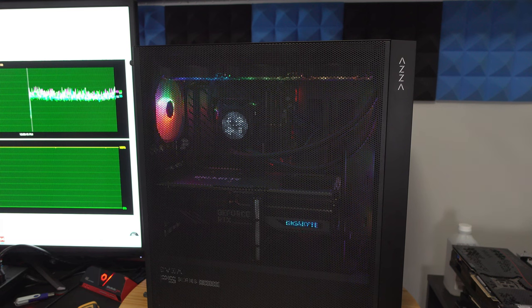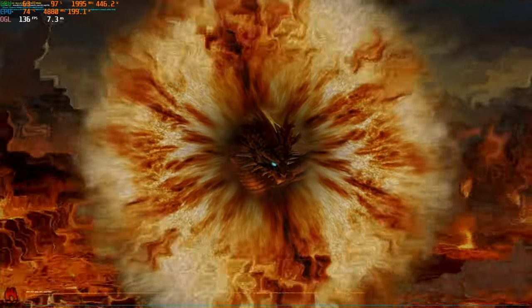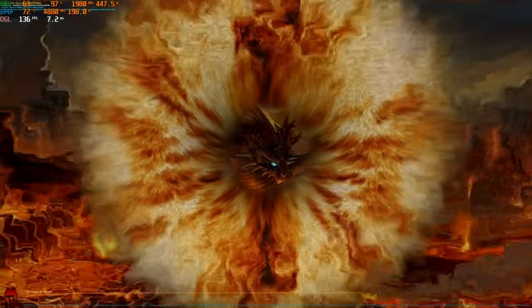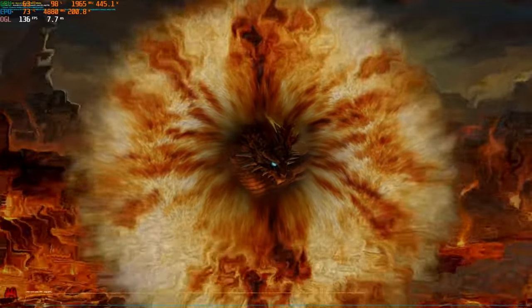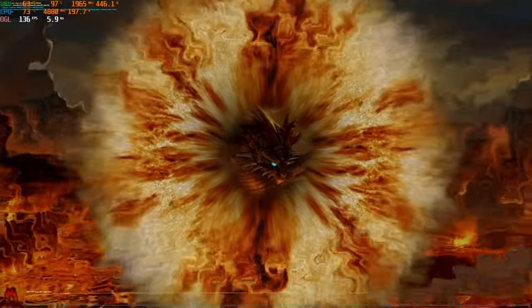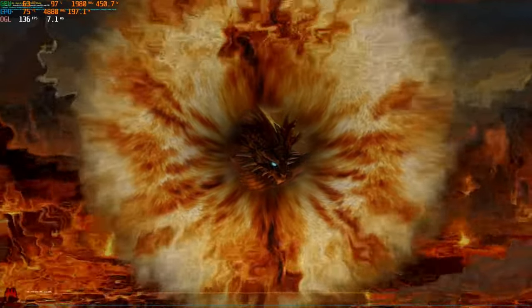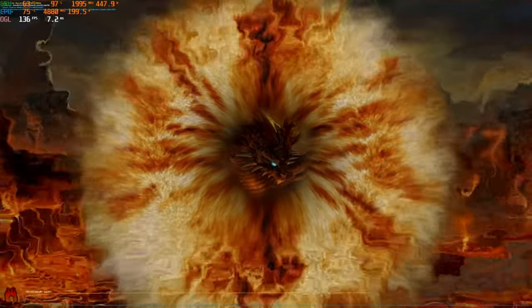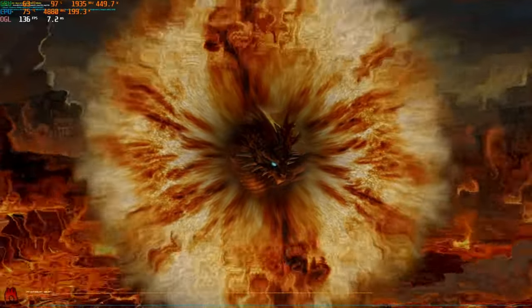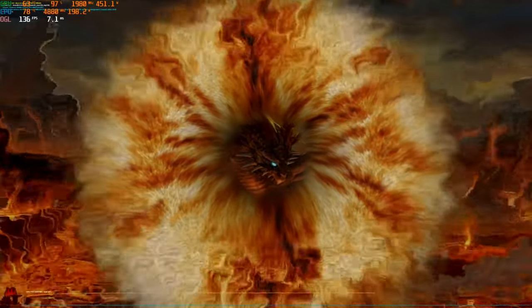So now let's see what noise level and power consumption with everything. So here we can see about 20 minutes of testing. The GPU is about 64 degrees. It has hit 65 degrees, 98% utilization. The CPU is at the highest, about 85 degrees. And that's still pretty low considering the temperature of everything within the system. Now, the system is taking right now 825 watts, 830 watts.